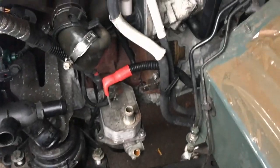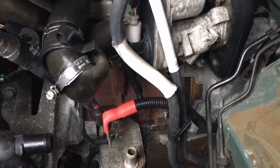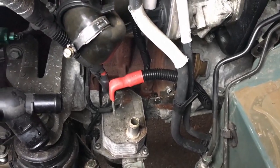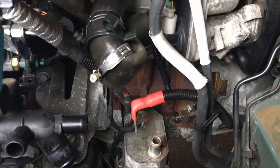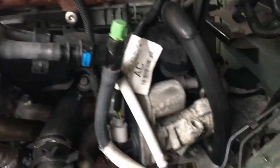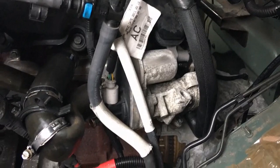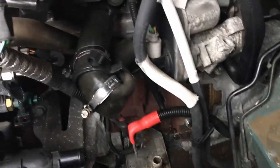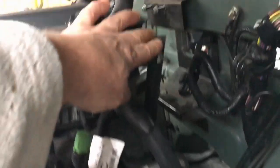Let's have a look at the engine. I've got the starter motor out; I'm not sure if that's really necessary but I took it out anyway as it may have dragged on the bellhousing as it came through and could have broken the casting. I've also removed a lot of the hoses from this side of the engine just to give myself some access into those bellhousing bolts. There are rubber pipes that go all the way around the back onto the EGR.